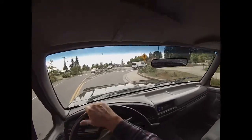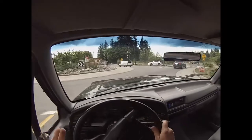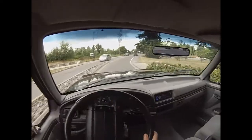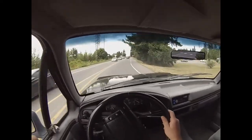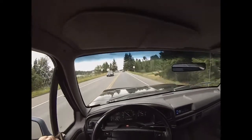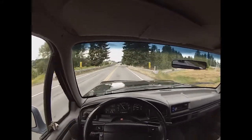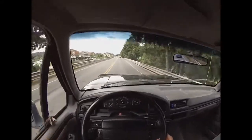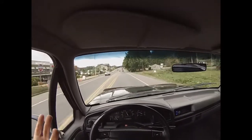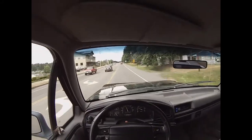So, like I mentioned in the other video and in the description, it's nice. It's OBD2, so it's just like any modern car that you buy today. If you have an issue down the road, 2-3 years, check engine light comes on or it's running weird, you can hook it up. You can go to Napa or O'Reilly's. They can even plug it in and tell you what it is. You don't need to find an OBD1 specialist, but most stuff 1995 and older in the domestics like Ford, Chevy, Dodge are going to be OBD1, so they can be troubleshot, no problem, but it can be a little bit more difficult, or maybe not every shop can do it.